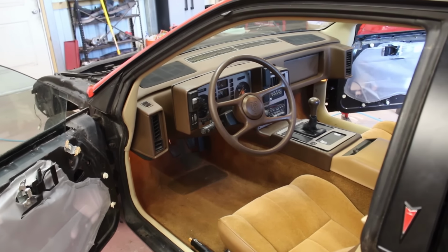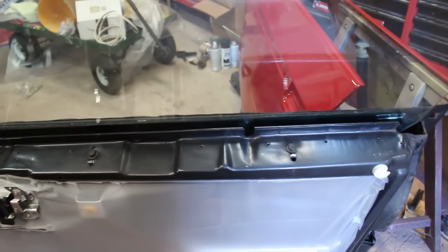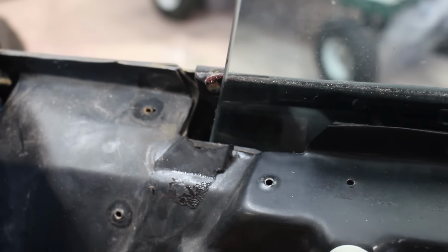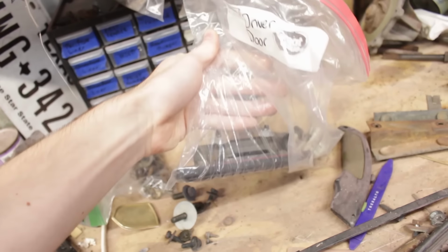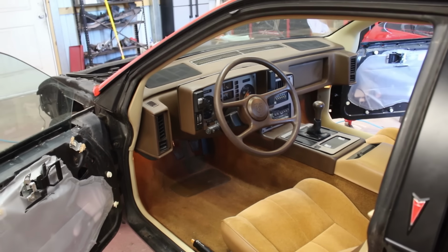On the actual chassis at least, clearly there's still the door panels to add, but that panel would cover the inner dew wipe that still needs to be attached, which blocks access to the nuts that hold on the mirror. That can't go on until the outer door skin goes on, but that can't go on until all of the inner hardware is restored and the outer trim installed, so I'm calling this good enough for now.